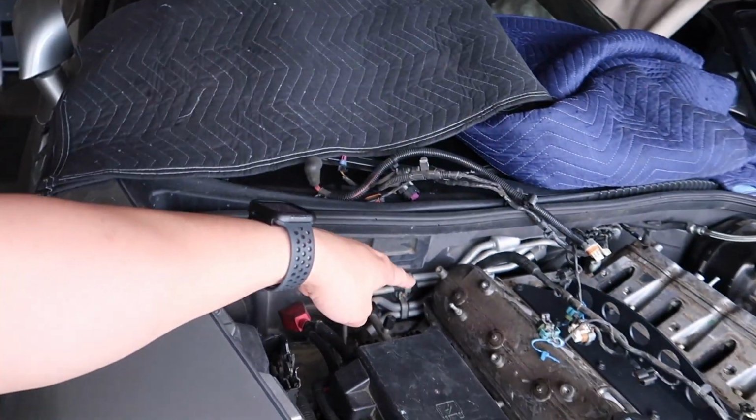So I was able to bypass that after a couple days. I did some research and saw that there was a solenoid that allows you to put it in neutral, so I manually just pulled that to put it in neutral. The reason why I needed to put it in neutral is because the bolt that holds the spline was on the opposite side where I couldn't access it. I'm talking about accessing it from the bottom bell housing port, like the inspection port. So again, it'll make more sense when I put pictures up and you can see what I'm talking about.